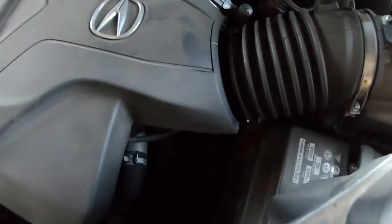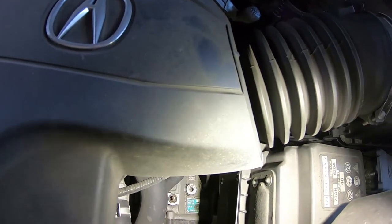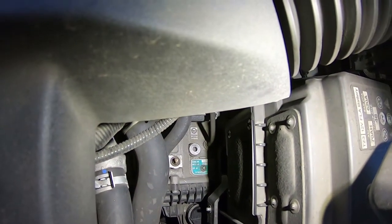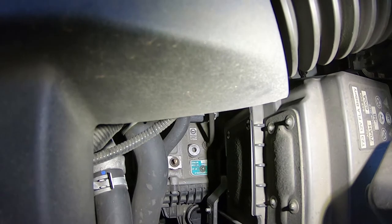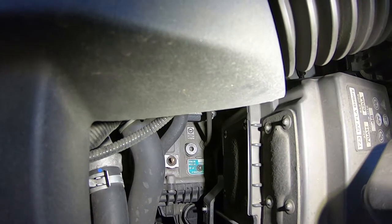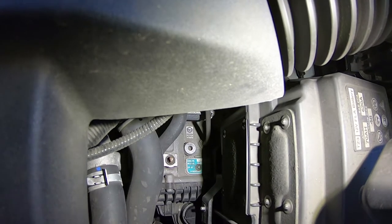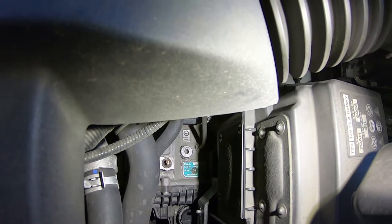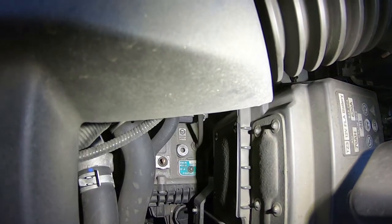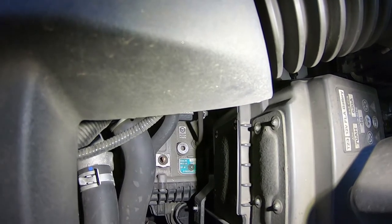What's next? We need some light. If you see that little spot down there right by where it says Honda ATF 3.X, you're going to need to stick a tool in there and open that up — that's your fill port. There's a level port on the side, and we'll get to that later, and then there's a drain port on the bottom. If you can't get this open and off, do not drain your fluid.